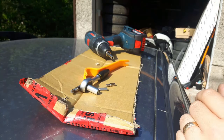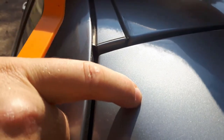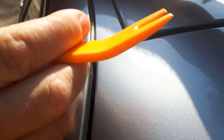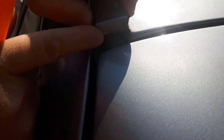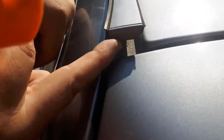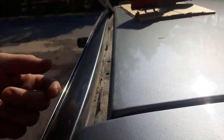Alright, let's get cracking. The easiest point to start this job is from the back — this is the rear spoiler above the rear window. Put this plastic tool right beneath this trim piece, then twist up, and it should lift really easily. With this you can pop the whole trim piece out.